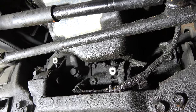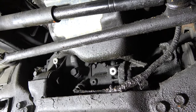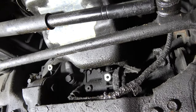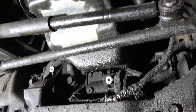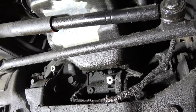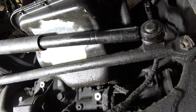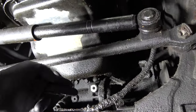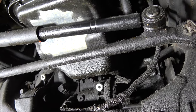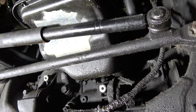If it's never been opened, you'll see orange RTV, which is what Toyota uses. When you install it back, I recommend using black RTV. And if you have the chance before you start, I recommend pressure washing the area — you can see how greasy it is. Make sure it's all nice and clean so it's easier to work with.